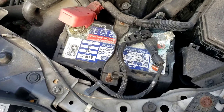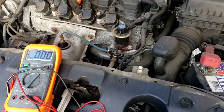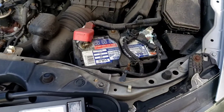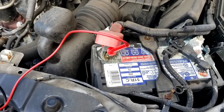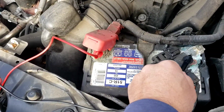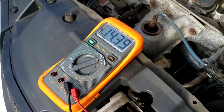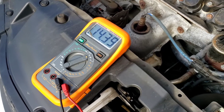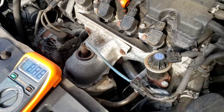You can also check it with a voltmeter or multi-meter — same thing — to see how many volts it is. Pick up the meter, positive and negative. 14 volts, so the charging is good and the alternator is perfect.